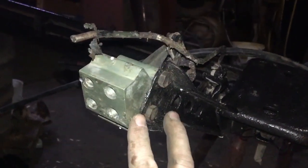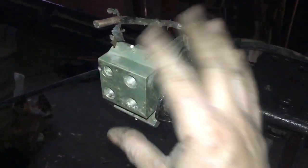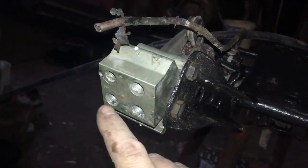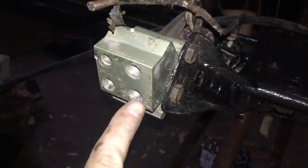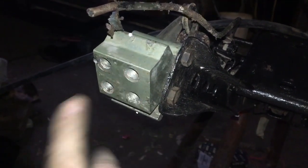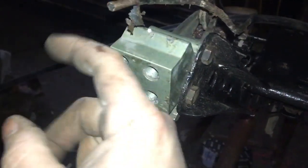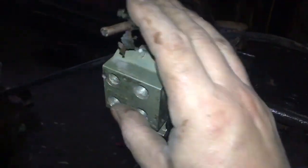And this is the brake equalizer brake bias valve. Thank you to Trevor for sponsoring me and giving me this. So on the very early Corrado — so that's the '89 — it had only three fittings, so it was like one line came in from the front and then it split left and right. This one has two lines coming in, so you've doubled the pressure coming in, and obviously this one here will do the left side and this one here will do the right side. Thanks to Trevor for that.